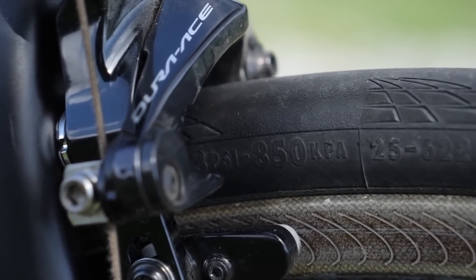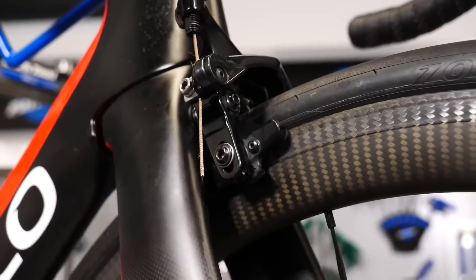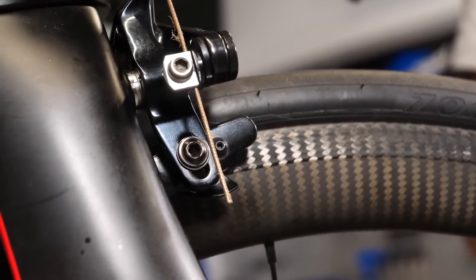There's a good chance, especially if you're a bigger rider or going down really steep roads where you're having to drag the brakes and brake hard, there's a serious risk of delamination — it's just a fact. When I visited Rob at Carbon Bike Repair, he was quite against carbon fiber rim brake wheels with a carbon braking surface. The technology has been around for quite a while, but it's one of the main advantages of disc brakes — that you don't have that issue. Carbon fiber rim brake technology isn't really being developed and progressed any further by manufacturers now.